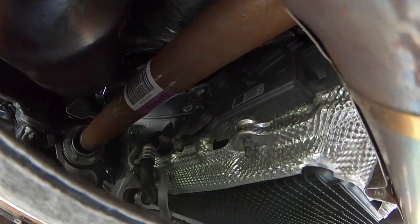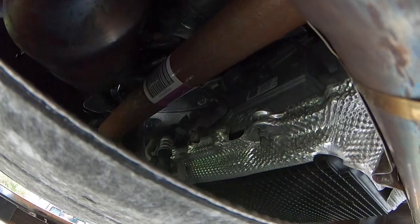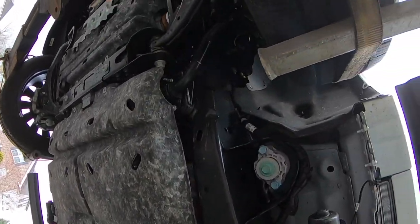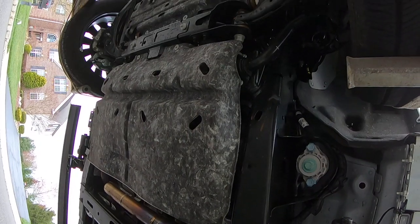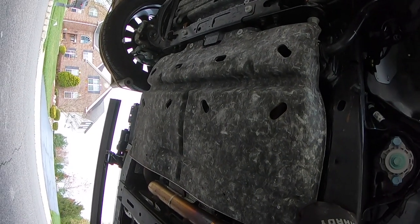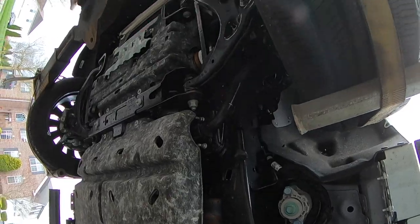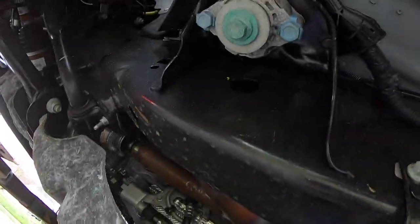There is the release for it. You got to take off that bottom bolt, pull that lever down, put the bolt back in, and it'll go into neutral. First problem, we have to take off this whole dust cover. Oh, perfect. The problem with these electronic transmissions today, they're super annoying. Okay, I wonder if that's a size 10.